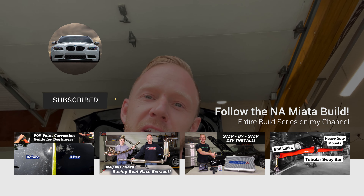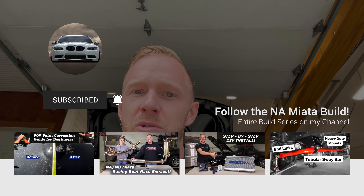Thank you for tuning in — hope you enjoyed this and learned something. Fender rolling is really pretty easy, you just have to be very patient, make sure everything's up to temp at 120 degrees, and keep working at it until you get it where you want it. If you want to follow along with the build, subscribe to Drive It Ryan and like and comment. I've got a track day Saturday so I still need to do coilovers, get the diff filled with fluids, and do brakes — a lot to do. See you in the next one.